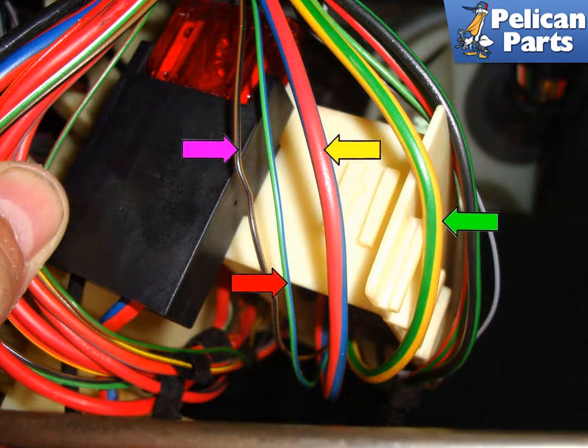If it does not have voltage, you can supply battery voltage through a fused jumper to bypass the relay and see if the blower motor now works. The red wire with blue tracer (yellow arrow) is the voltage supply into the relay, pin 30, from fuse number 28 mentioned earlier. Make sure you have battery voltage with the key on. You can use the voltage on this wire to jump voltage to pin 87 to bypass the relay, but make sure the exposed metal of the jumper wire does not come in contact with ground or you will create a short and blow the blower motor fuse.